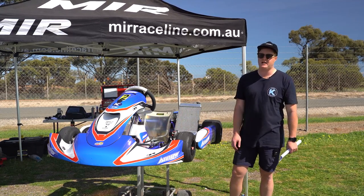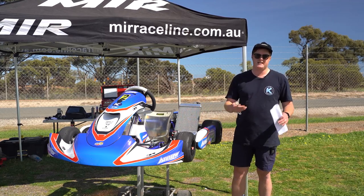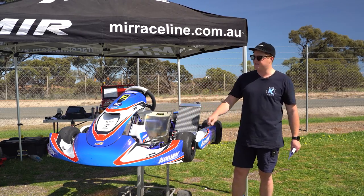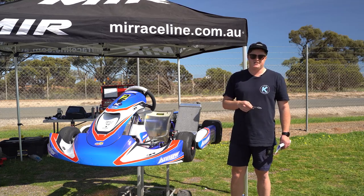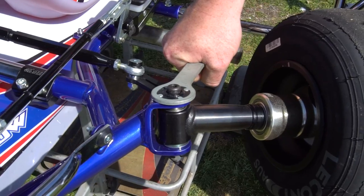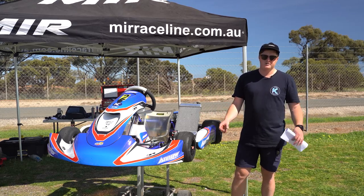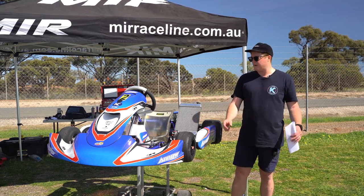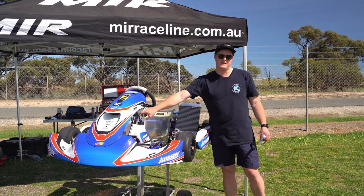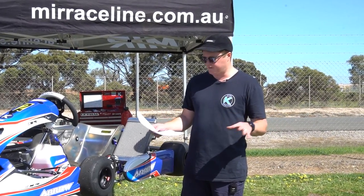You don't get a seat, so you have to supply one. But when you get the Arrow, you get a full seat bolt kit — heaps of bolts and washers that are self-adjusting and swivel, so you get an even pressure between your seat and seat stay with no need to bend the stays. With the camber and caster adjusters they also give you a dedicated tool to adjust those settings. They also include a full wheel spacer kit so you can adjust your rear track. Lots of little cool user-friendly things that make the Arrow really good value for money.